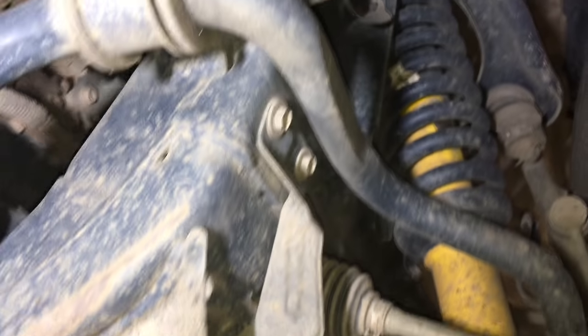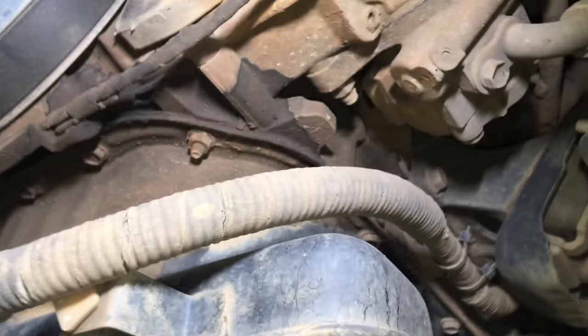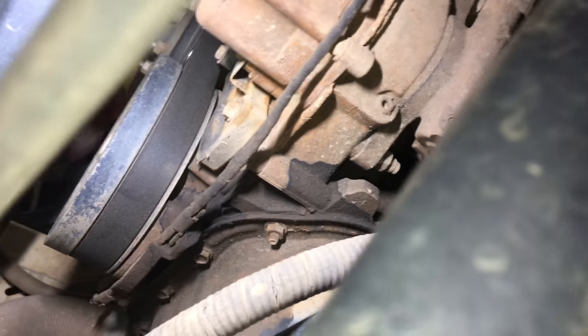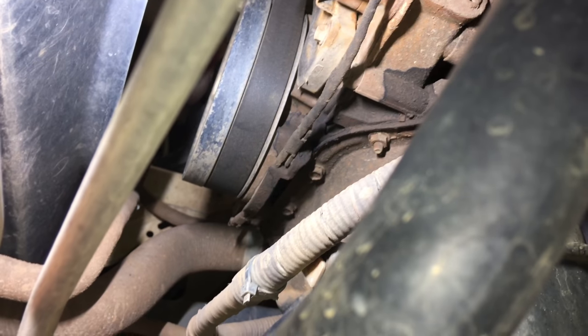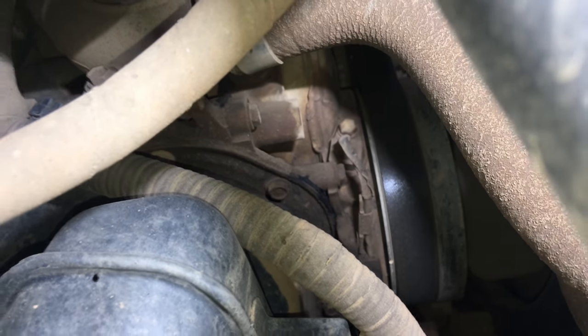The engine is fairly bone dry. There's a bit of oil there but that's not an oil leak, just a weep, we're not worried about that. It's most likely not the vane pump, not the vacuum pump, the O-rings look good. It's not the sump, it's not the cam seal, not the crank seal. Maybe the O-ring on the sensor - that's about $200 but I don't think it's that either, and it's certainly not worth fixing. 276,000 Ks, virtually bone dry, which is good.